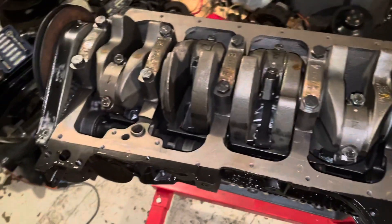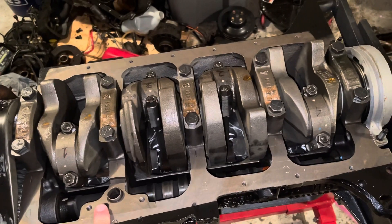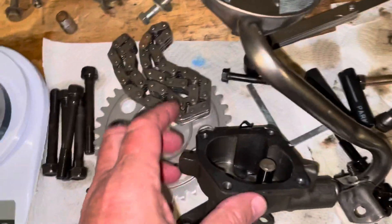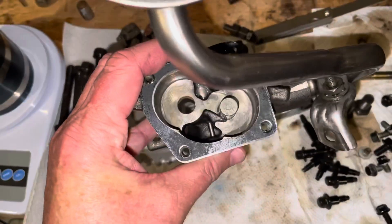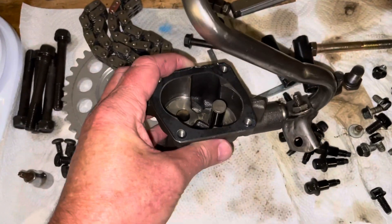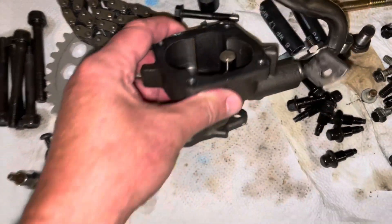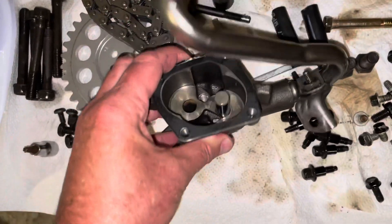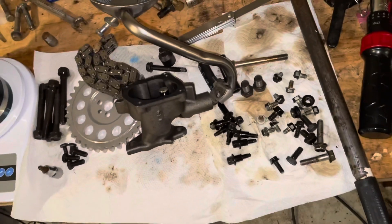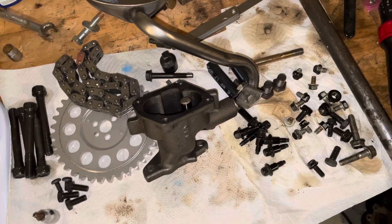What I'm about to do now is mount the oil pump — it goes right here. Once the oil pump is in, I'll put the oil pan on. Before I mount the oil pump I'm cleaning it. This is the 3-liter oil pump; it's very similar to the V8 and 4.3 oil pumps. The only difference I notice is there's a gasket on this flange here, which I don't typically see on the other oil pumps. I've disassembled it and cleaned it out with Shout — I use Shout because it's biodegradable.